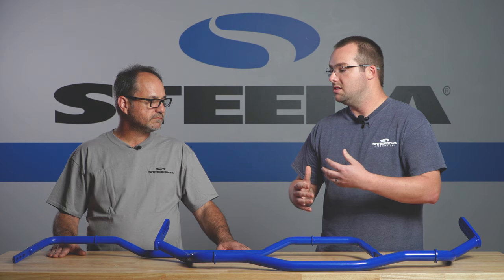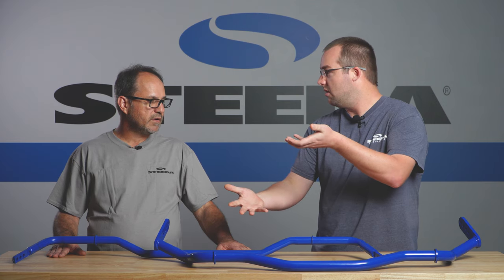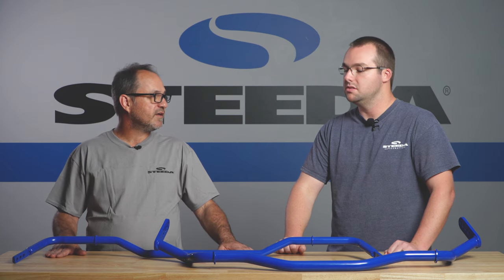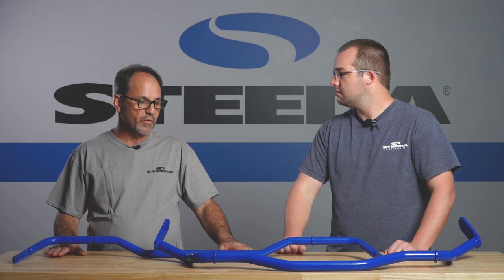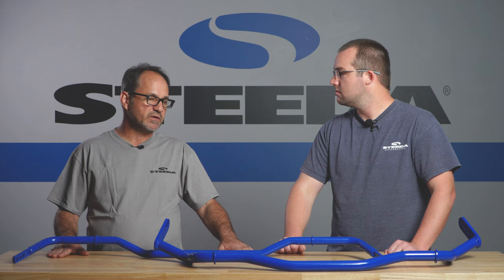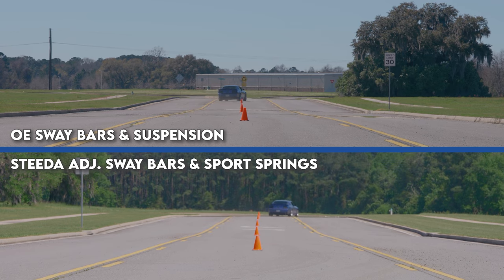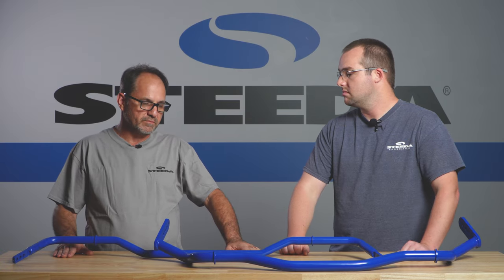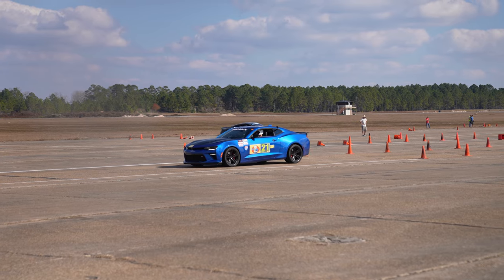So it's safe to say that the relationship between sway bar and spring — if you go higher in spring rate, you may want to go softer on the bar. If you have a softer spring rate, you may want to go higher on the bar. Yes. The old rule of thumb was soft springs and big bars, or stiff springs and soft bars, to be able to maintain your balance. With the weight of these cars this day and age, that's not always true, but it's still a good way to look at it. The factory springs are fairly soft, while our springs are higher rates than stock, though they're not significantly higher than stock.